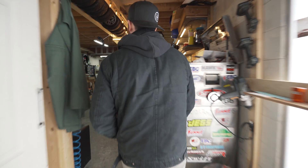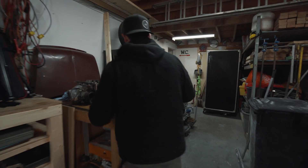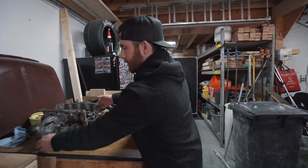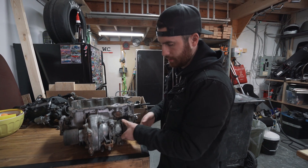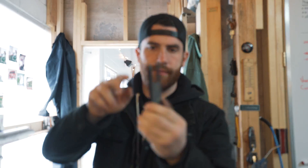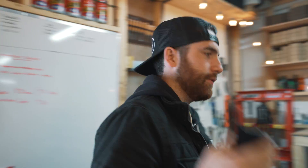So we've got a transmission on the bench here. What you're talking about is the seal that goes in between here and the outboard. Let me pop this up a little. Tech tip: I made one of these tools just out of stock steel, shaved it down and cut it — this helps to be able to pop the pot joint out. You can buy these, but it's easy enough just to make your own.